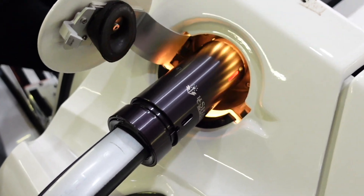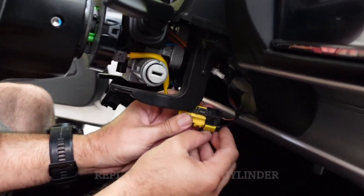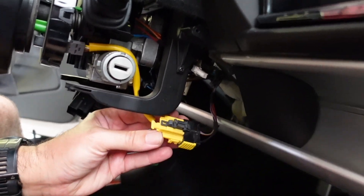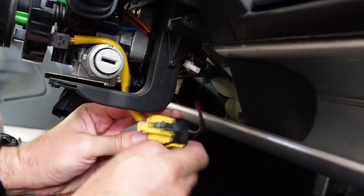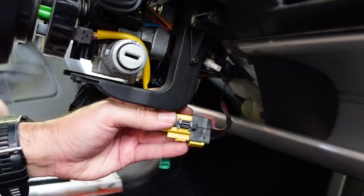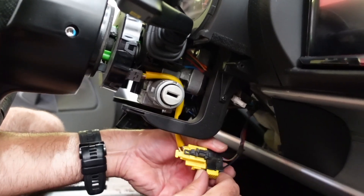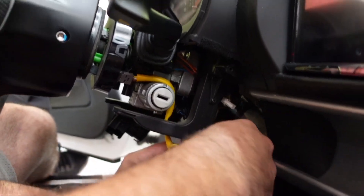That's a beautiful sight right there. Alright, so we are going to unhook the airbag now that the car is off. You just get this yellow harness down here and pull down this tab and it will release — should release relatively easily. Not this coming loose. So you just pull that yellow tab and get out of the way just in case.